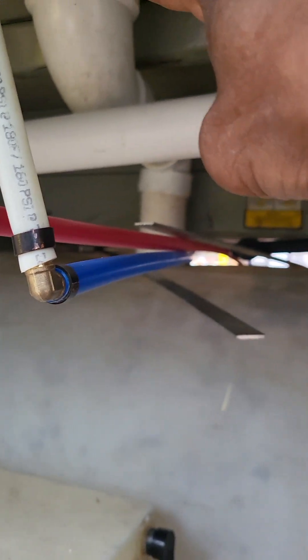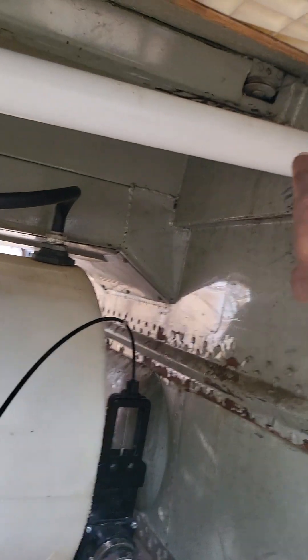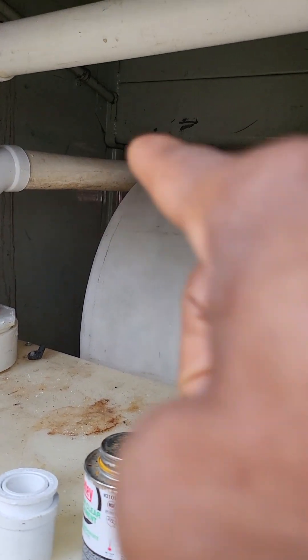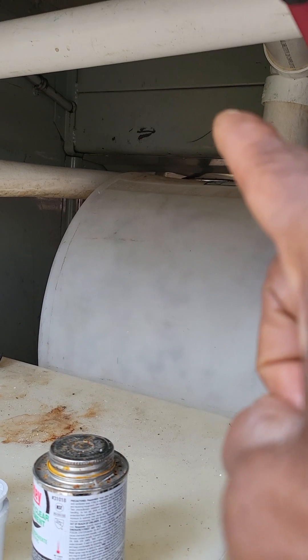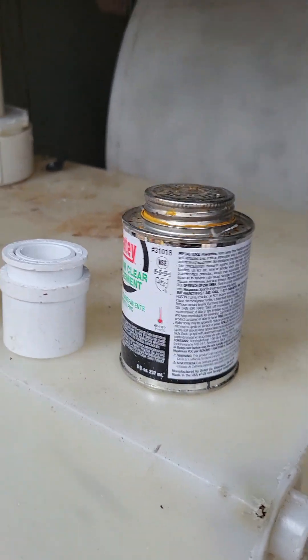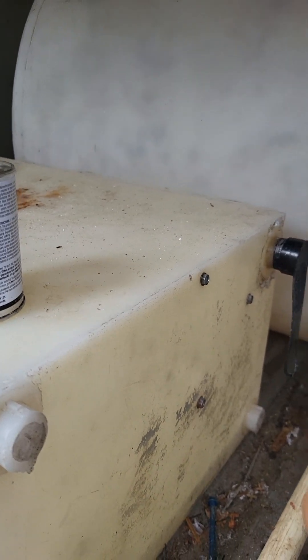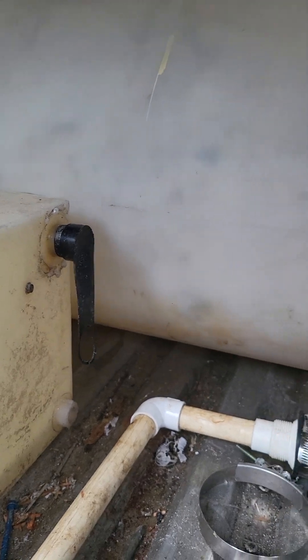This is the toilet line — it runs into the black water. This is the shower line that comes from the shower and goes into the gray water. That line comes from the washer, the bathroom sink, and the kitchen sink, and it runs into the gray water. The gray water tank is not that large because most of the gray water isn't raw sewage — it's just used water. Some may have soap in it, some may have body acids in it, but it won't have raw sewage in it. Some of it can be dangerous too.